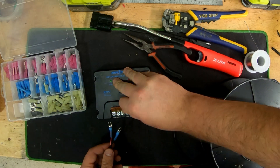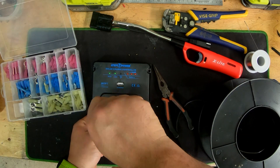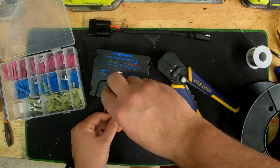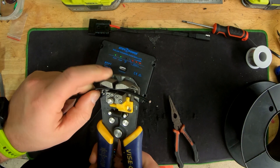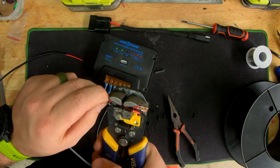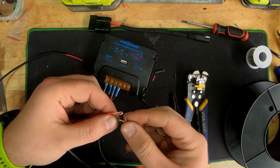I did have to crimp a little bit in order to fit those pins through, just tighten them down, and then I made another wire as well. Now in order to make a connection I'm going to flood solder these wires with an Anderson plug. To do that you crimp them down a bit more than normal and fold them over themselves, just because it's a very thin gauge wire.